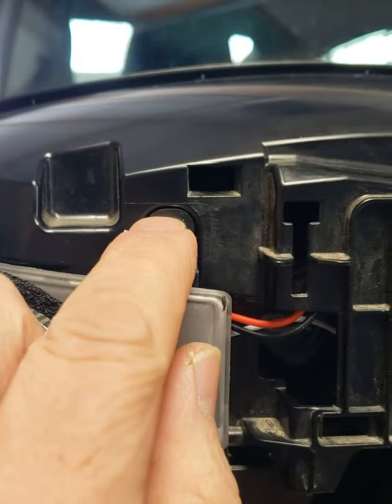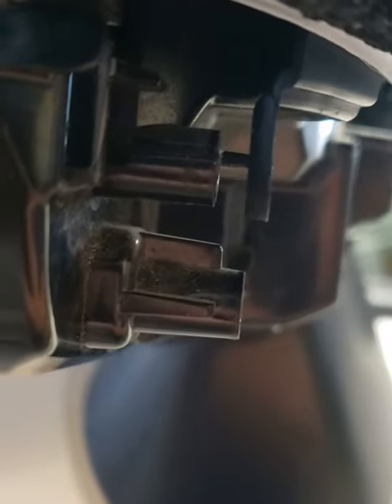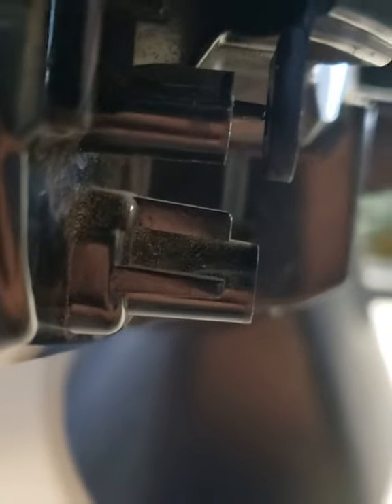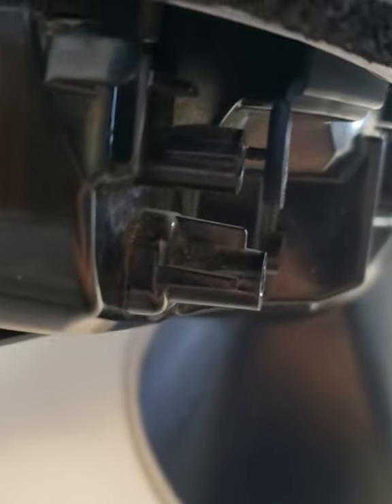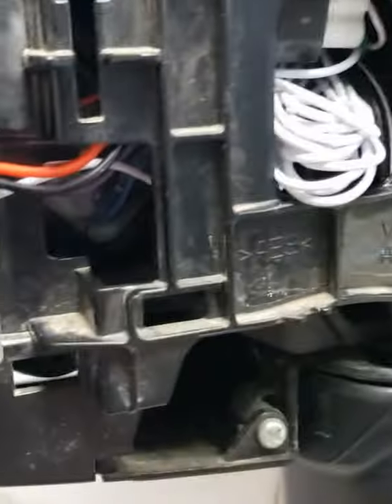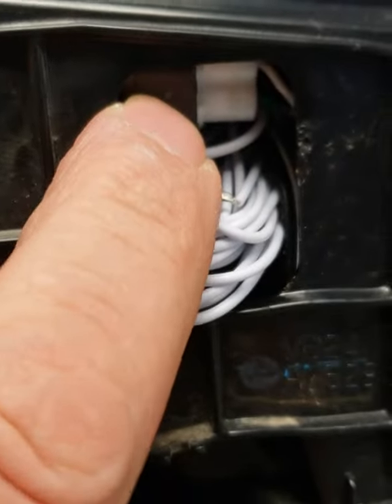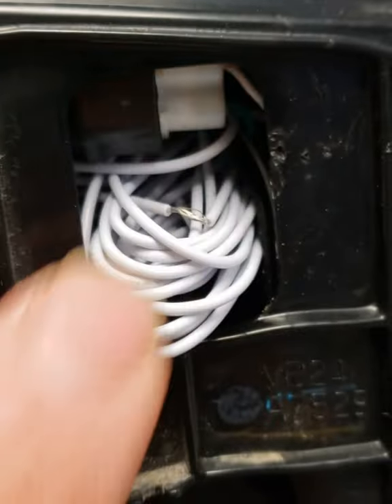When you install the turn signal light, push this tab all the way up and flush against the housing — it helps line up a slot there. There's also a little gap between the tab and the plastic on the housing. I'm going to get a small spacer because if you tighten the screw all the way down it bends the tab, and I don't want it to break. The JDM Toy light has a long white wire coming out for the DRL function, and the black and red go to a black plug.